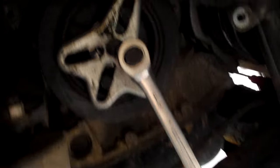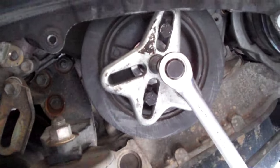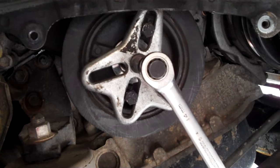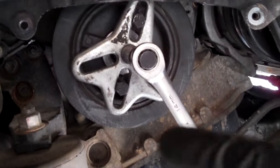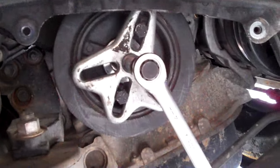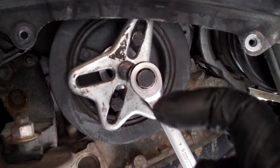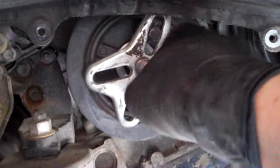You take the bolts and screw them into the harmonic balancer. You'll either have three holes or two like this one. Dodge has their own special one with no bolt holes — it's actually got a Briggs and Stratton stamp on it — with three little arms that go in at different areas. It's not like your typical three-jaw puller with a hook; it's very square.